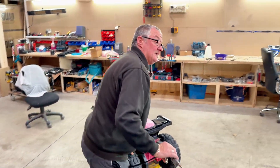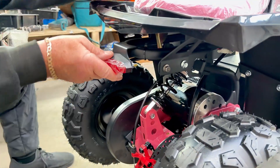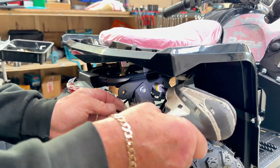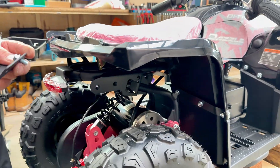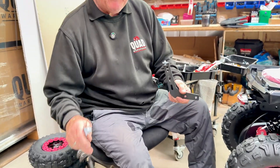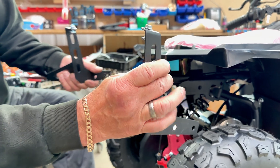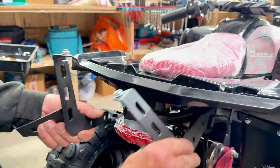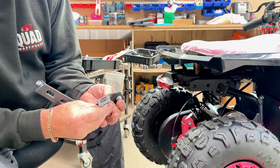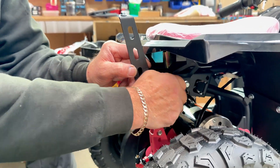You'll find the dust caps in the box with all the tools. Under the seat at the back there are four bolts — one on either side. Take those off. Then go into your box and find the two large brackets. The brackets have got a bend on them so make sure you put them on the right way: looking at the back of the bike, the bend goes to the left on the right-hand side, and bends to the right on the left-hand side. Put the bracket you just took off behind and into the bracket, then screw it back into place.